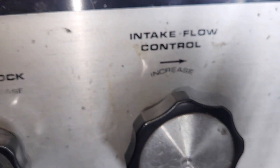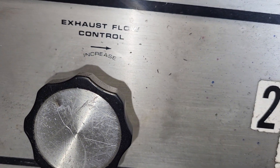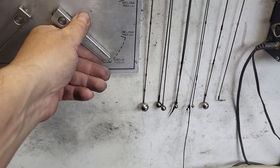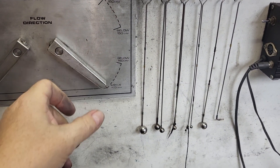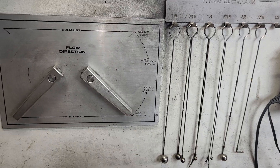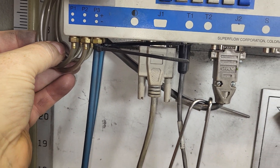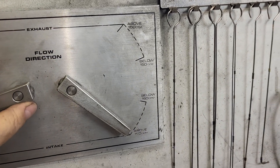Looking right down into the bench, it has a plexiglass divider plate. The air comes down, hits the divider plate, and either goes to the right or the left. One way is intake — that goes to the big valves like we saw on DV's flow bench. The other valve on this side is your exhaust flow. Then it uses this damper to let air in and out from around the motors. These are vacuum lines that go to the Flocom, so it knows whether it's reading exhaust or intake.